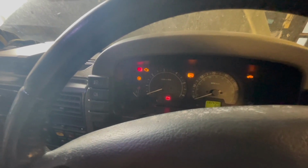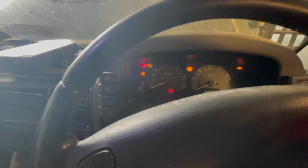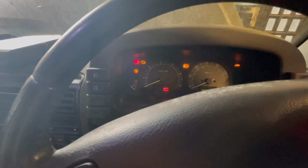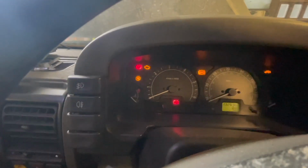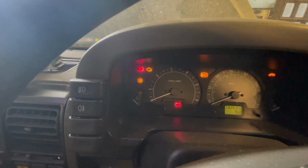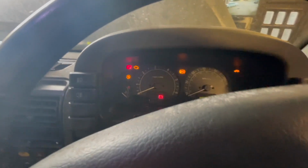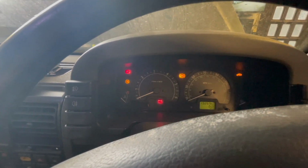That's going now through its bleed procedure. Typical, just as I cancelled, the fuel pump stopped. Oh, there you go. It's come back on again because it's doing its bleed procedure. So in a minute, the pump will stop again, and then it'll probably start again until it's bled enough to start. Now, when you change the fuel filter or you run out of fuel, whatever silly things, this is what you normally have to do to get it to start.